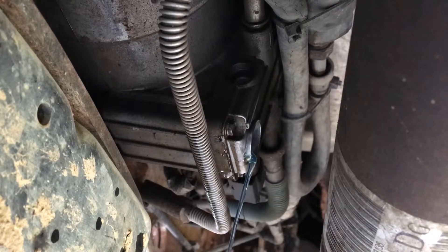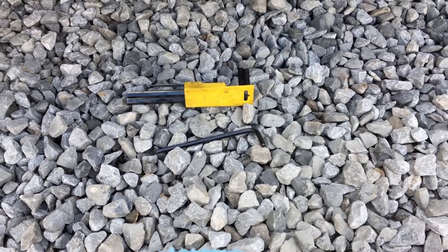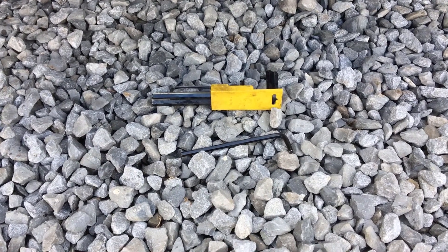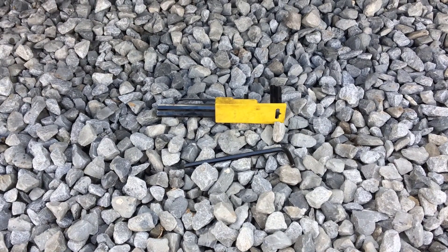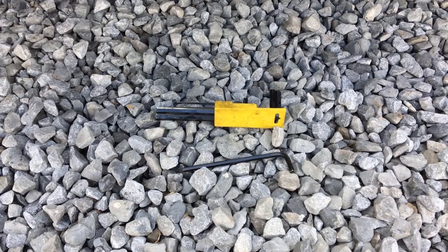I've got the plug out. I'm going to let this drain for a little while, hopefully to flush out whatever water is in this filter housing, and hopefully that will take care of our problem. I ended up changing my gloves to get away from the diesel, but I'm going to clean up my Allen wrenches and then we're going to start the truck up to see how it runs and look at the dash — everything should be good from here on out.